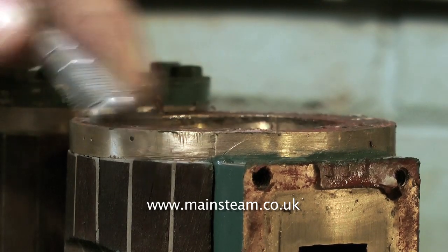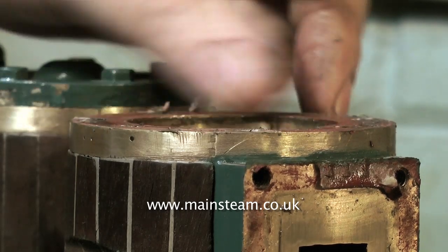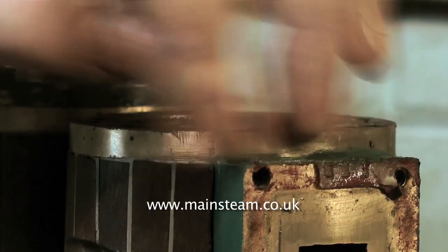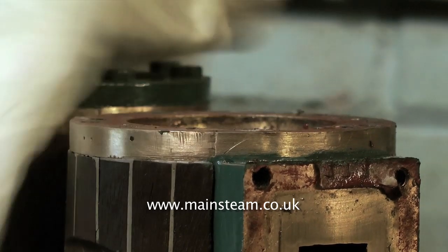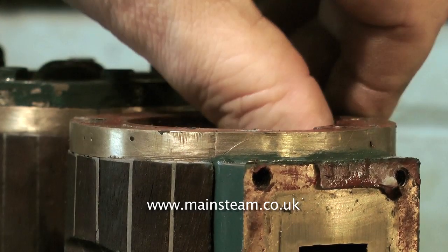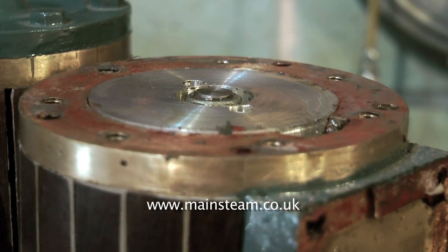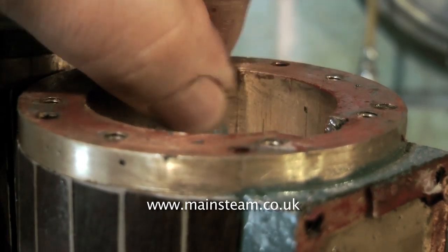It's a very strange engine — the bottom end is quite industrial, made from steel and gun metal and the normal materials, and then the cylinders up here are made from brass, which is pretty naff really, bearing in mind they are two-inch bore, seriously big cylinders. And when I look inside the cylinder, what do I find? A recently fitted aluminium piston. More about this later. Thanks for watching.